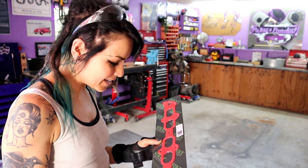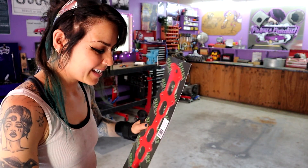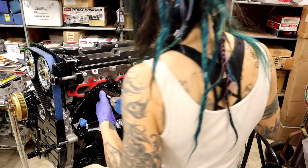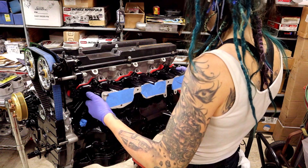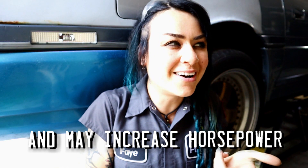I'm going to bring this to the machine shop today. You place this in between the cylinder head and the intake manifold in place of the intake manifold gasket, and it will reduce intake manifold temperatures by quite a bit. Cooler temperatures means denser air — more molecules closer together — and that basically increases the efficiency of my intercooler and the whole intake cooling system. I've never tried one of these before, so this is going to be an experiment. I'll link it in the description and I'm really excited to do a before-and-after and just see what a difference this thing makes.